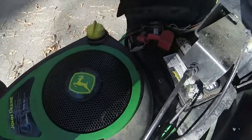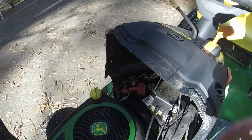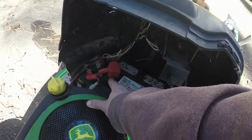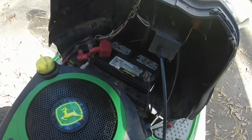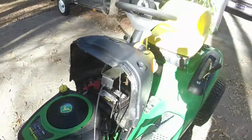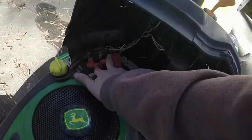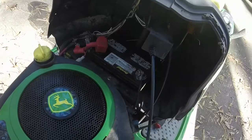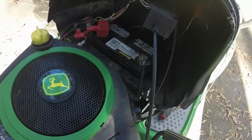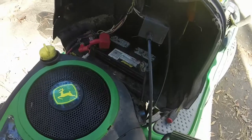All right, so this battery is good, and I wanna caution y'all, you need to use a left positive terminal battery. The ones that I have here, thankfully I've got another one. This is a Duralast, and the other one I have is a Federated. Just be mindful that with a left terminal battery, because the positive cable is so short, you can adapt to have the opposite end terminal battery with the right positive. But if you want to plug and play, a left positive battery.